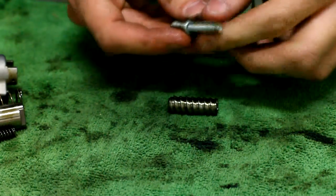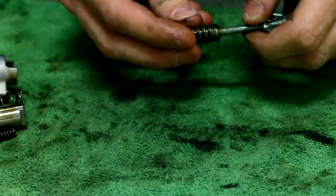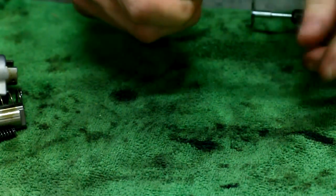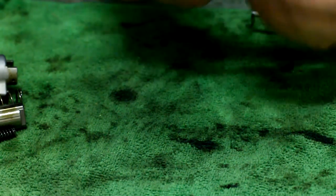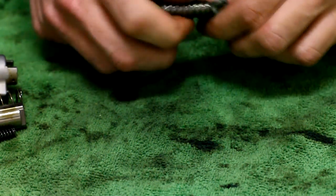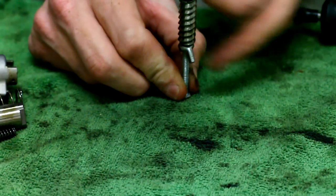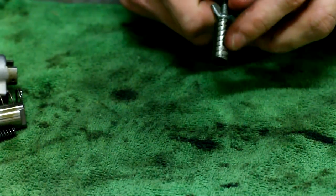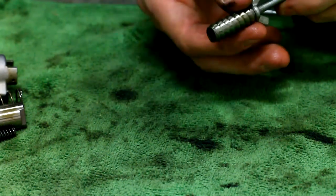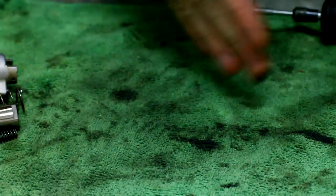What you're going to do is take that bolt with the wing nut on it. The wing nut is not as important at this moment, but I use this as kind of a handle. One end of the worm drive has a threaded hole in it. You're just going to put that bolt into that hole — it should only turn a couple turns and then you'll feel it bind up, just two or three threads. Turn that wing nut down and lock it into place. Now with that bolt end in, you're going to hold it up like this. When you look at the worm drive, it's got these smooth teeth and that is your problem.